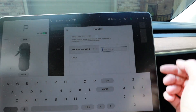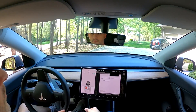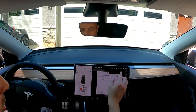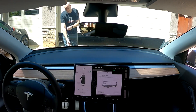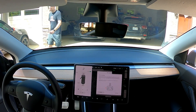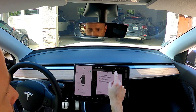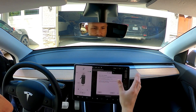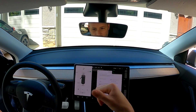Now if you want to do another garage door opener, you just hit that and name the front one. We're going to go up to the front and do the big garage door — naming it 'Big.' I've got that remote right here. I'm in park, got the garage door opener in hand. We're going to set mode, continue, get out and hold the button. That flashed. Now we have to hit the Learn button because this one has that as well — it's nice being tall. Now it's training, and before we hit Save we're going to test it. We hit the button — usually takes a couple of times — now it's closing. Now we can save that.